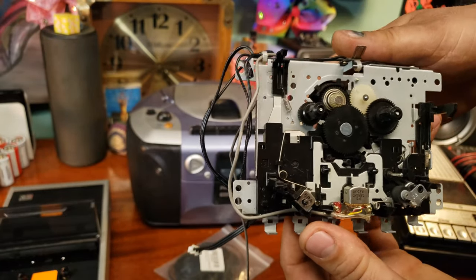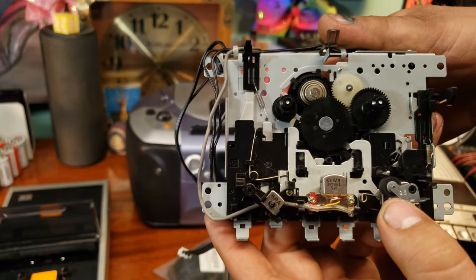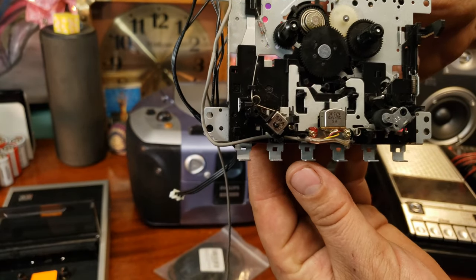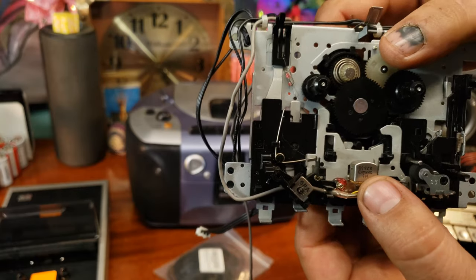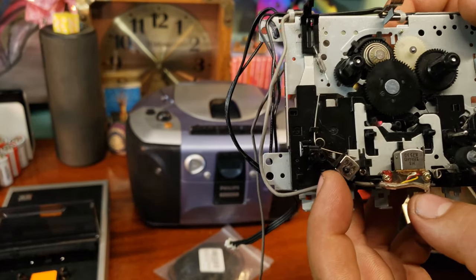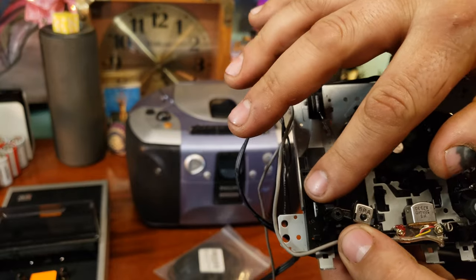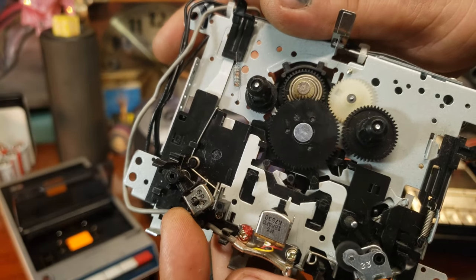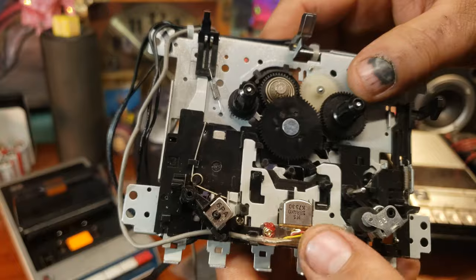We're talking about the Philips Compact Cassette — the proper name for a cassette tape. Part of their design was that the tape head actually moves up to meet the tape, and then you have the pinch roller pinching between the capstan. Here you can see the pinch roller gets pushed up against the capstan and the play head rises up to meet the tape. One negative of a permanent erase head is it can get dirt caught in there and potentially mess up your tape. There's a tiny little spring that holds the erase head down, and another spring holding the whole mechanism.